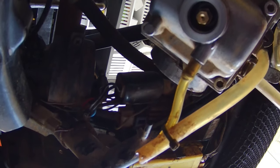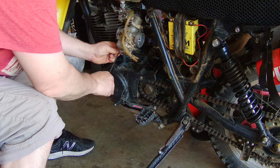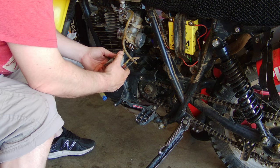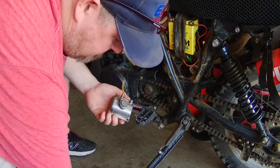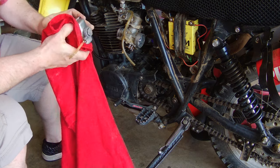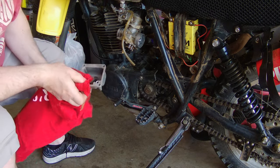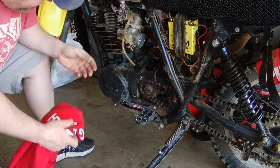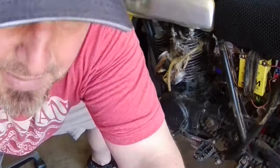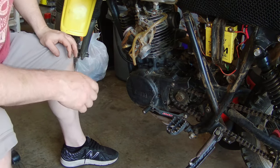As you can see, there's the main jet - that's the main jet and that's how you would change it. Now what we're after is the pilot jet - main jet, pilot jet - and it's a flat head. You need to be careful with these; they will strip out extremely easy. So you've got to use a special screwdriver. Depending on the jet, this is actually a carb sync special tool by Motion Pro.